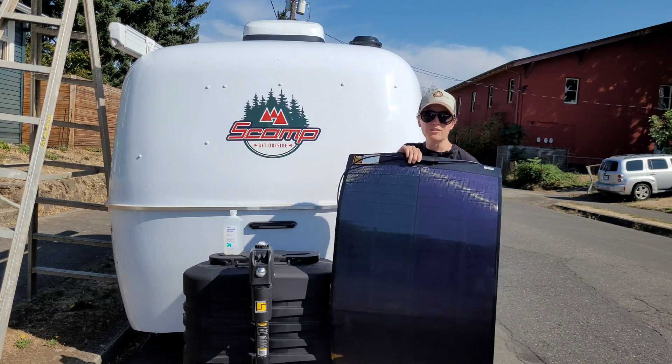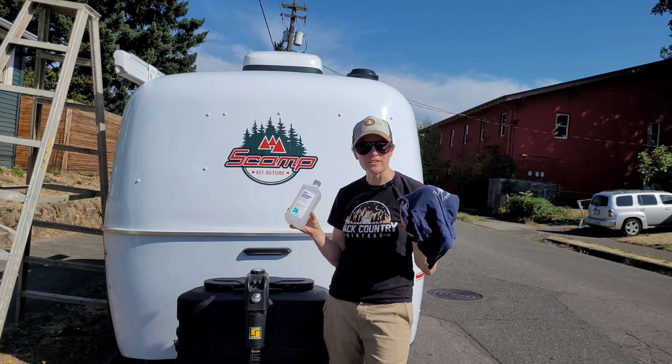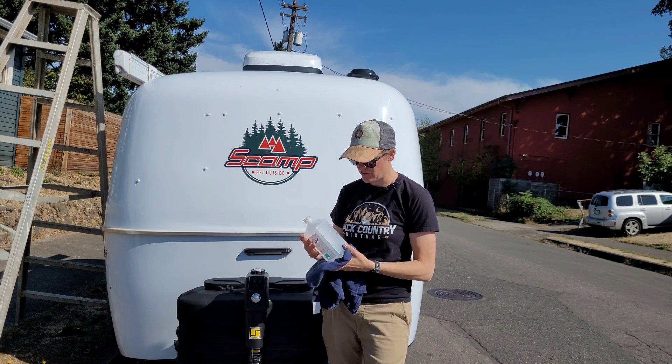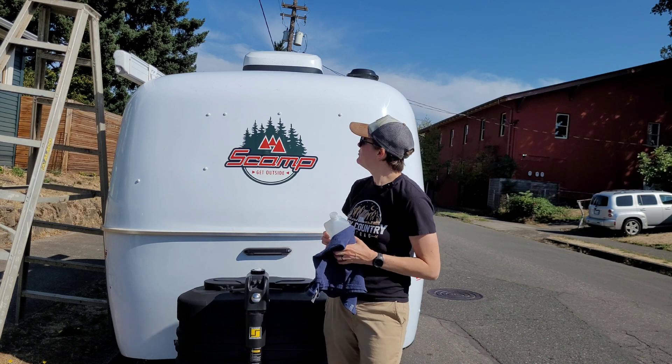Today's the day we're putting it in, so let me start cleaning. Since this solar panel option is an adhesive, I'm going to start by cleaning all the surfaces that I need it to adhere to, to get a good strong adhesion. I want this thing to last years, so I'm just using a rag and some rubbing alcohol, and I need to get up on that roof best I can and clean it off.